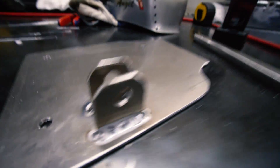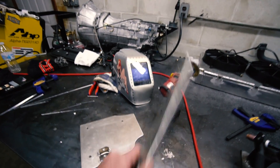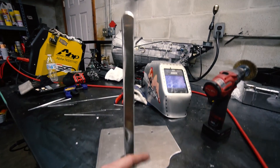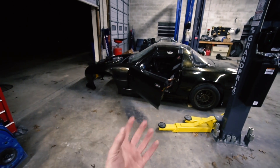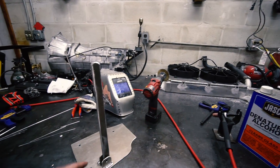Tabs are welded — they're a little off because I just took what I could get with tacking since the back one did not want to tack, but the welds came out good. After not being able to get a clean looking weld to save my life, it's nice to get a nice clean consistent weld. We're going to drill a hole in this — probably multiple holes for lightweight purposes. A bolt will go through there, and then we've got to build some sort of clevis, a rod going back, and then a sandwich plate for the bottom to distribute the load through-bolting the master cylinder. Tomorrow I've got to run to the store for bolts and stuff to make the rod and clevis. We made okay progress today — I was going to knock out the whole handbrake project, but we pick it back up tomorrow.